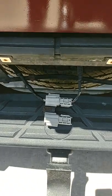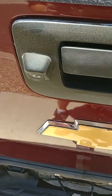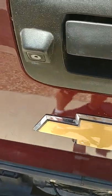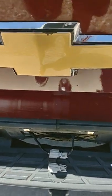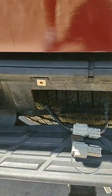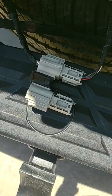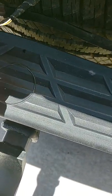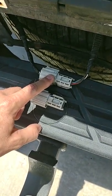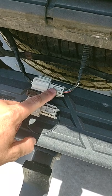Hey, how's it going guys? Just wanted to do a quick video on how to fix the backup camera on your Silverado, Sierra, or other GMs — I think it's 2007 up to 2014. If you look on the back, this is your license plate, so just remove your license plate. These two connectors here — one of them is not used; I'm not sure what that one is for. This top connector is the lead connector for your backup camera.